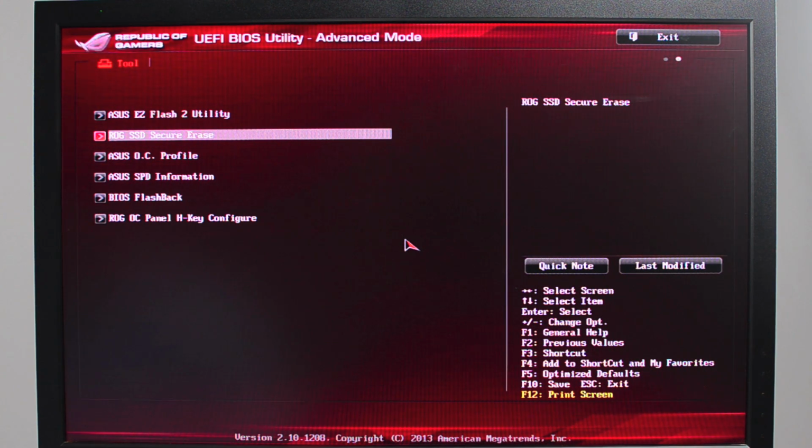Yeah, because you definitely want to, right? The danger there is if your power is interrupted during a secure erase. The procedure is you set a password, do the secure erase, then you remove the password. Correct. If you reboot during that process before it's complete, you could compromise the drive and have a drive that's now locked, right?